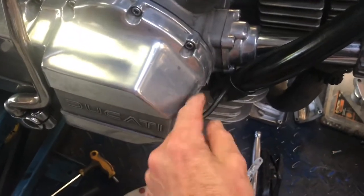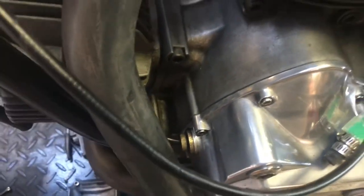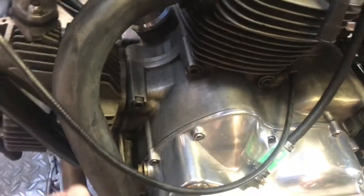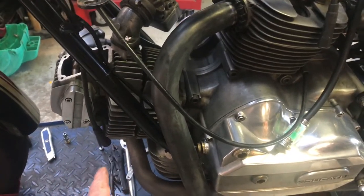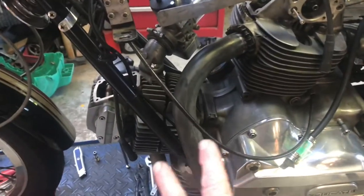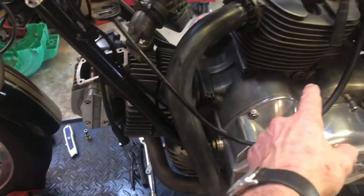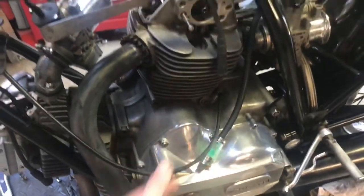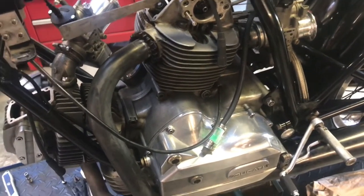The whole wiring harness collapsed a couple of years ago — these wires were shorting out, the plastic destroyed itself, and the ignition wires were crossed so it was nearly breaking my leg with kickback. What was happening was the motor fires this way, but both cylinders were firing at the same time — four sparks per cycle instead of two — so as one was sucking in air, the other was firing, driving the kickstarter up and nearly tearing my Achilles tendon apart.